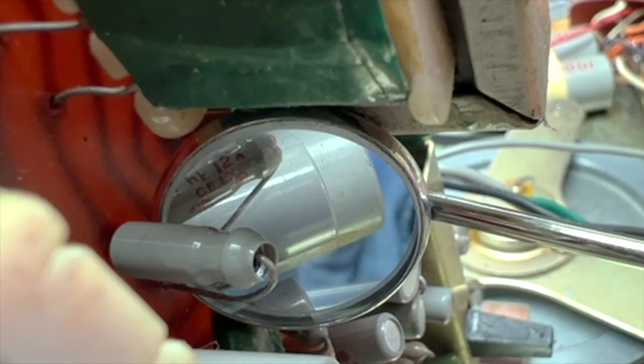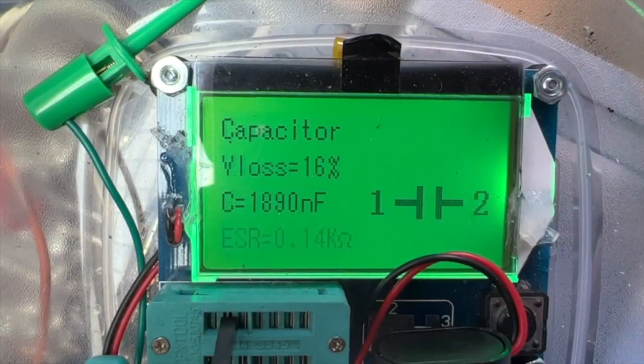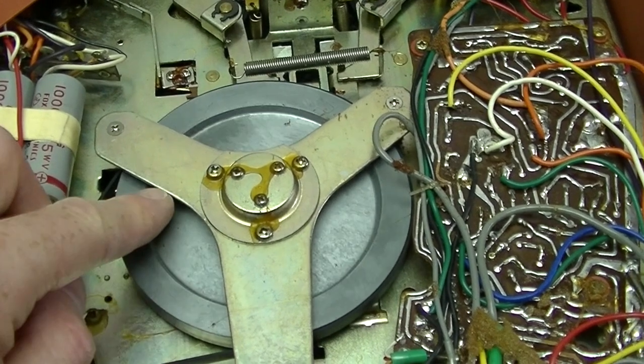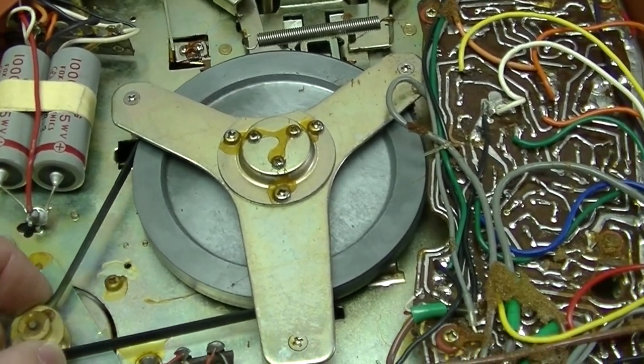After further testing, I found that the electrolytic capacitors were faulty. According to my tester, they weren't bad — they were really bad. I also noticed that some of the drive belts had become loose and were slipping. It was surprisingly difficult to obtain the belts, but I finally got them. And that brings us to where we are now.